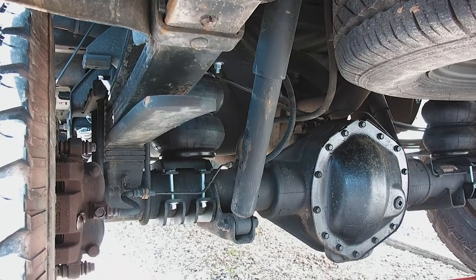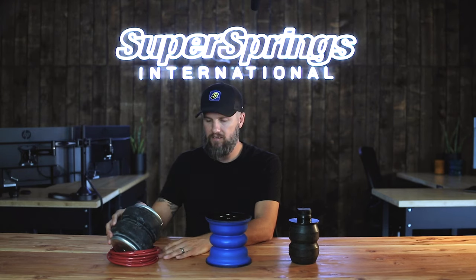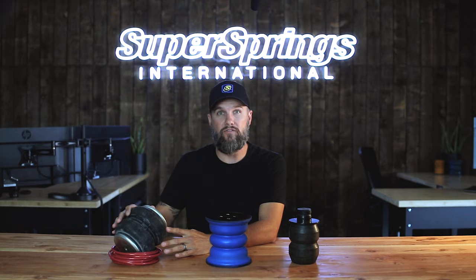Some things to remember about airbags: first, they essentially replace your vehicle suspension, and when you're riding on airbags, they render your factory suspension a paperweight. Second, they restrict the vertical travel on your vehicle — stretching them can cause damage or leaks. You also need to adjust the PSI based on your current load, adding or bleeding air, which may require running airlines and an onboard compressor. All that equates to ongoing maintenance without solving for unloaded ride comfort.